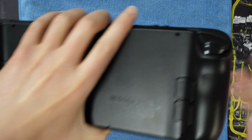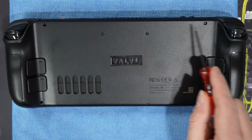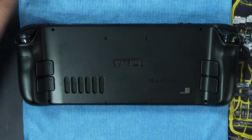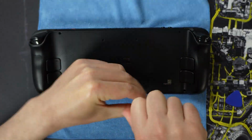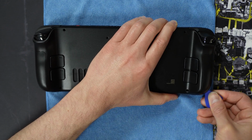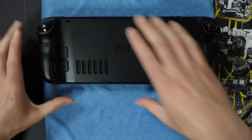Now that you have what you need, let's get to the Steam Deck OLED in part 1 of my guide. Rotate the device and approach removing the backplate. To do that, there are 8 screws you need to unfasten for removing the backplate. Use the PH0 screwdriver that came with the Handheld DIY mod package to unfasten the 8 screws. Next, detach the backplate by using the guitar pick that came with Handheld DIY's mod package. Check my online guide for more details on this part.